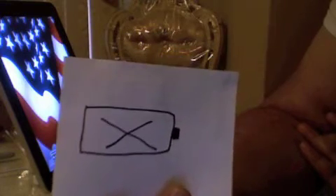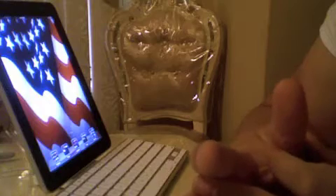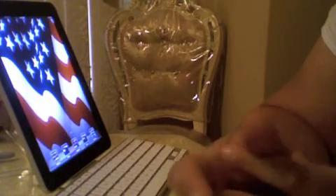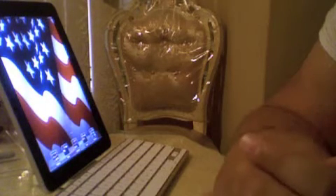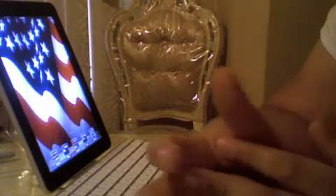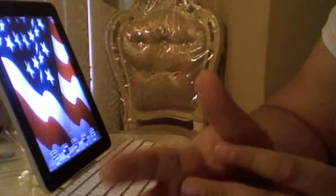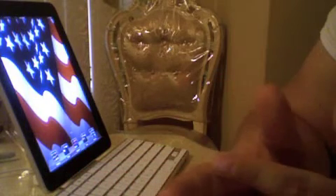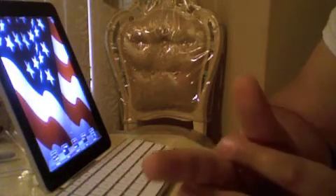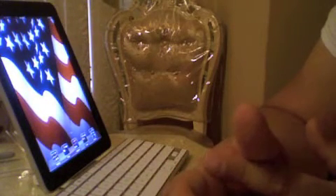Here's what I did to fix this. Step one: shut down your MacBook. Step two: remove the battery and unplug the MagSafe. Step three: turn your MacBook over, open it, and hold the power button down for five to ten seconds — I did ten, but five seconds should work.